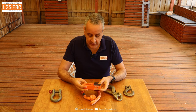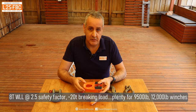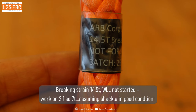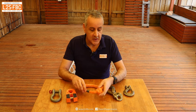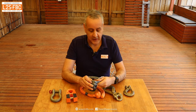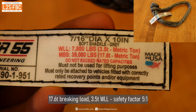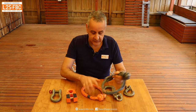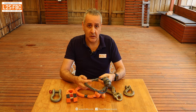The Factor 55 flat link has an eight tonne rating, but that's actually its operating limit. Factor 55 tell me it will break at more like 19 or 20 tonnes, so again that's more than strong enough for recreational winching. The soft shackle has 14 and a half tonnes in it, but that's the breaking load, not the working load, so we probably want to halve that - making it good for about seven tonnes. I do have another soft shackle here from Factor 55 with a breaking limit of actually 17.6 tonnes, and they only recommend you go down to three and a half tonnes working load. Either way, I think both would be fine for winch recovery.